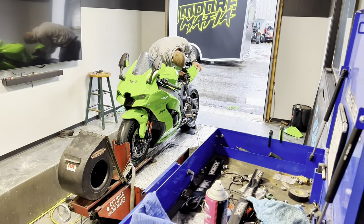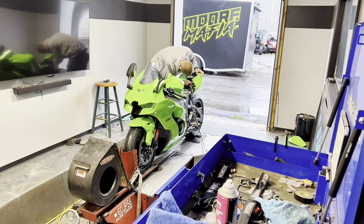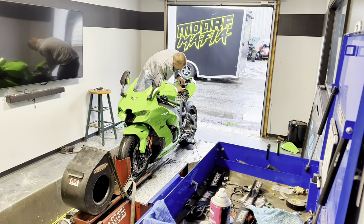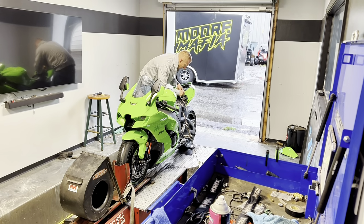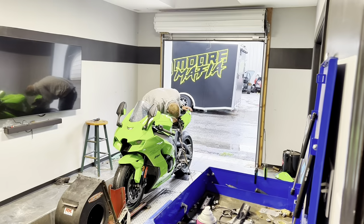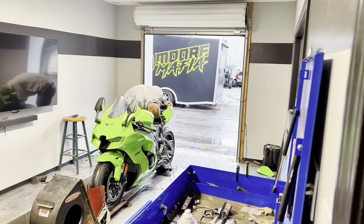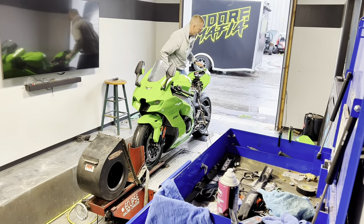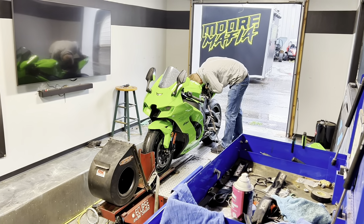But at that point, your throttle plates still aren't open. Sure, sure. But a PC6 has a bunch of EPA restriction bullshit on them, in other words, you can't adjust the fueling under 6,000 RPM. Really? I didn't know that. They only work running wide open throttle. And they only work within a 10% window because that's all the government says they should be able to. Really? Yeah, that's info I didn't know. Well, Power Commander ain't going to tell you this new product ain't as good as the old one, but that wouldn't be a very good selling point.